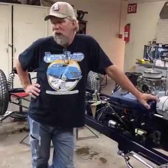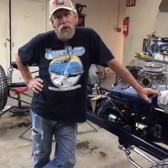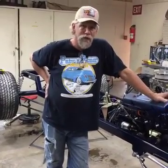They've come a long ways. We used to solder a resistor in. You could even solder an existing 1157 light bulb in it to do enough, but have this hidden light bulb under your car just so you're pulling the resistance to make your flasher work. Then they started coming up with special flashers that work. But even that, they all weren't working. Some would work better than others, and some had to be grounded, and some didn't.